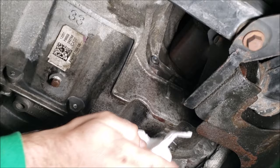All right, so having just used the factory jack that came with the car, placed right on the pinch weld where the arrow shows behind the front driver's tire, we have the tire lifted off the ground. Since the lug nuts are broken loose, we're now going to remove the rest of the lug nuts and pull the wheel.